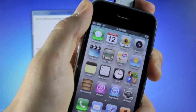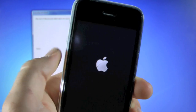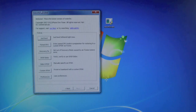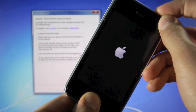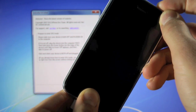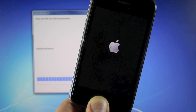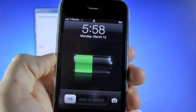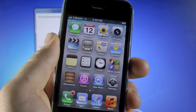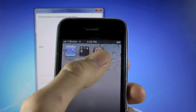Now power off the iPhone and slide to power off. Go ahead and insert your T-Mobile SIM card and reboot the iPhone. Of course, we're going to have to tether boot it — this is the last time, I promise, unless you turn it off yourself. Go back into RedSnow, select 'Just Boot Tethered,' hold power and home for 10 seconds, let go of the power button and keep holding the home button. Once RedSnow recognizes your iPhone it'll automatically start the tether boot process. Wait about 2 minutes, then wait about 5 minutes for your iPhone to find your carrier network. And there you go — unlocked on iOS 5.1 with the 3GS on T-Mobile and jailbroken.